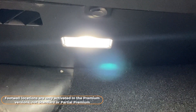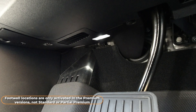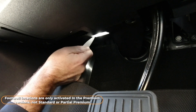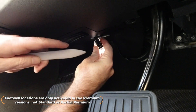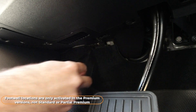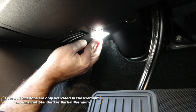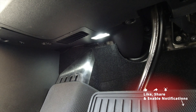Over to the driver's side, which is a little more annoying because of the pedals and steering wheel being in the way. Look for the little notch — dig in, twist, and out comes the bulb. Not much spare cable on this one of course, just to make it even more annoying. Release the old bulb, slide the new one on, and snap it back in — which is actually quite difficult, but there we go. That's how you replace seven bulbs in a Model 3 plus two footwell lights.